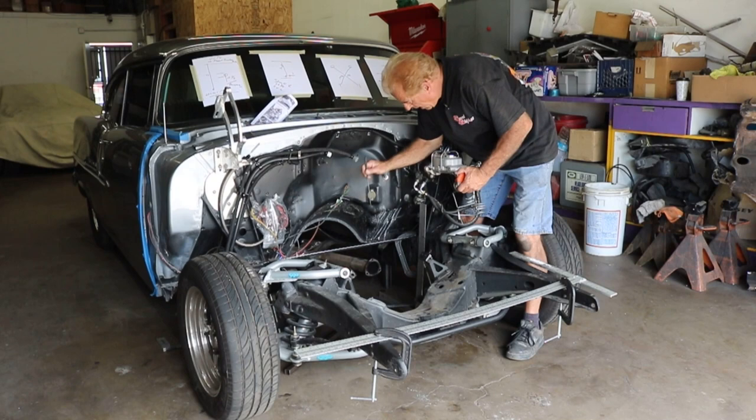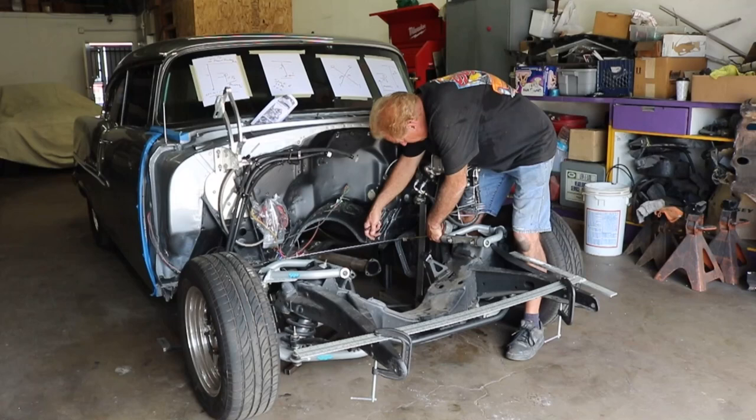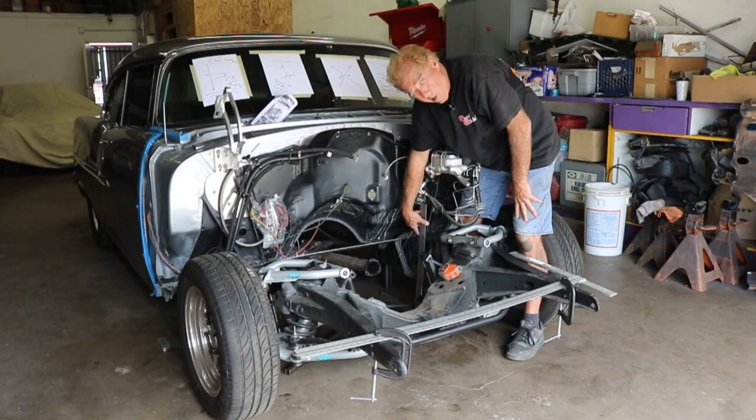As I mentioned, Jim Meyer wants the bar all the way to the back of the body mount right there — they want 4 inches. We're going to go 4 and 3 eighths because we have some damaged frame and we want the capability to push it back if we have to. So let's measure that, use our square, scribe it. Now we're going to do that for the outside on both sides and then we're going to start cutting it up.